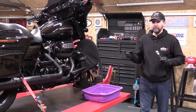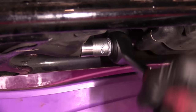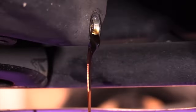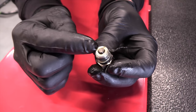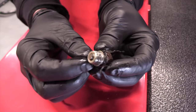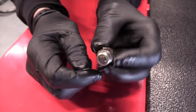Use a five-eighths socket for the drain plug, same as the other two oil changes. As always, check your drain plug — it's a good source of information. The magnet on the top will collect any chips or swarf that have come out of the engine. There's nothing on it, so we're all good and healthy. We do have some old sealant on the thread and the o-ring itself is all torn up, so we'll clean this up and replace the o-ring nice and fresh before it goes back in.